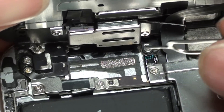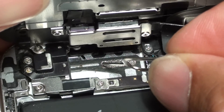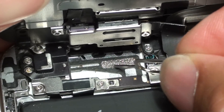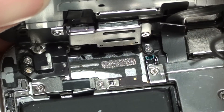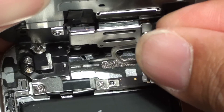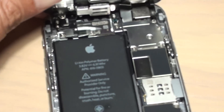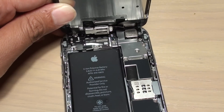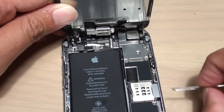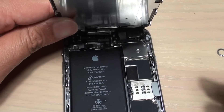This can cause signal drop, no service, or searching. If you open up the screen and see this soft patch is missing or has been pushed up or down, try to realign it to cover the metal contact on the antenna. Replacing the antenna can also solve the problem, but it's a difficult job — you need to remove the logic board. The antenna flex cable is fairly cheap to buy, but the work involved can be difficult depending on your technical skills.